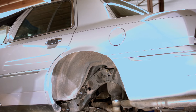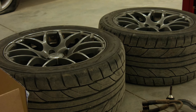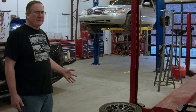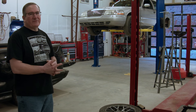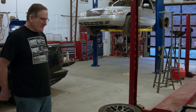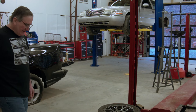A while back we upgraded our wheels and tires. We've got a 295/40/18 on the back of the car, which is about the biggest thing you can fit in a Panther wheel well. That helped traction somewhat, but with a 4.7-to-1 first gear in the 10R80, we still didn't have any traction without a limited slip obviously. So that's one of the things that was deferred and needed to happen.